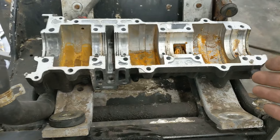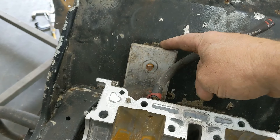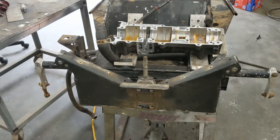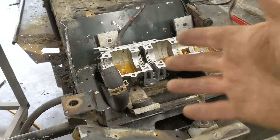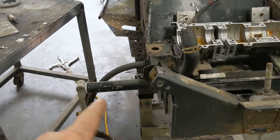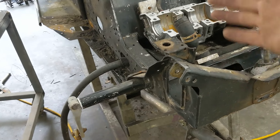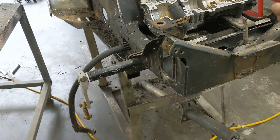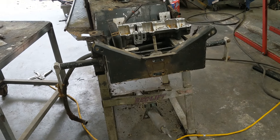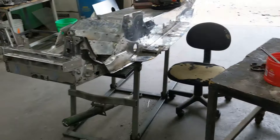I set the engine in here — the cases, motor mounts down in here — and I can see I'm going to have to re-drill this hole back here over an inch to move that motor mount over one inch so they can line back up. This used to have an XC 600 triple motor in it; now it's going to have an Ultra motor in it, so just a little modifying — no big deal. I'm also going to get this sway bar out, not going to run a sway bar on this sled. It's not going to have a belly pan, not going to have a hood. I might extend the shock towers to run longer Walker Evans shocks — haven't decided on all the fab yet, but dimple-dying and lightening it up for sure.